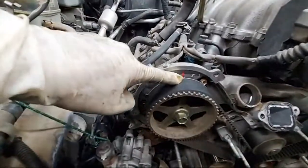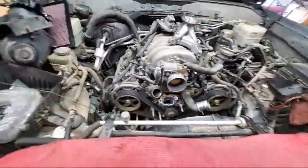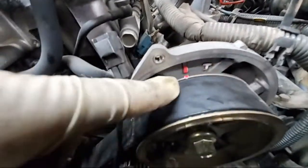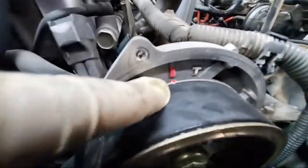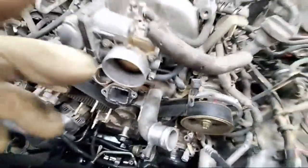Your mark is this one — that's your timing. The right side is the passenger side, left side is the driver side, same way — letter 'T' in there and the marking there with the incision on the camshaft, like a little groove in there.